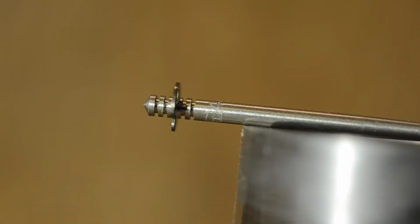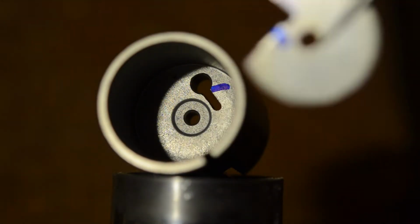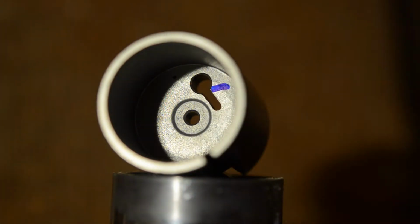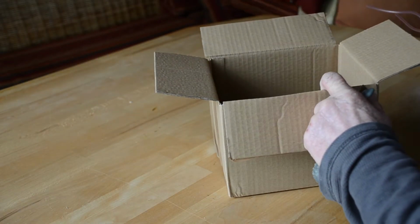Preset for the needle seems to be third position from top, so I will start with this variation. Mikuni provides this clever little plate which keeps the cable and the needle in position, like so. More mail order magic.